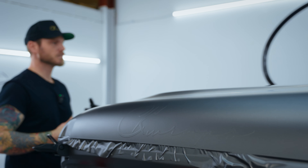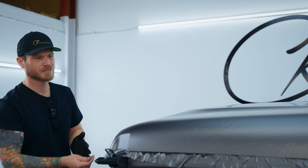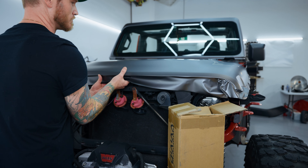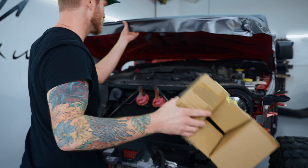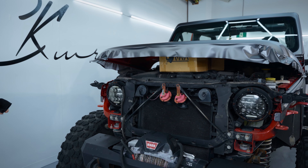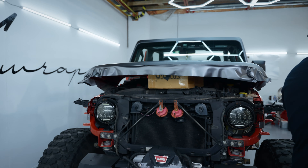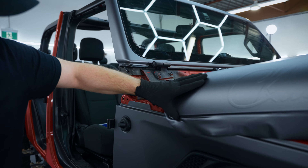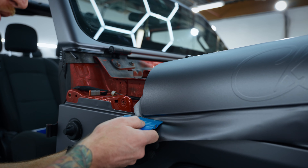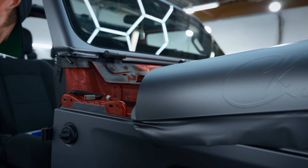This hood when I lift it goes really high up, so I have a box — I'm going to lift it and put it on the box so it's not so high we can't reach it. That came off really easily. Now our edges are all elevated, which makes it really easy to wrap them and do our cutting. Let's push that around the corner, and I want to make sure we're not sticking to the fender, so let's push the film underneath to give it extra slack. Now let's heat it.